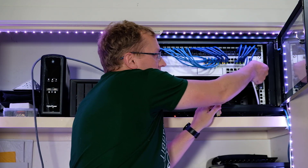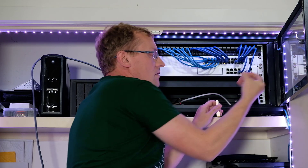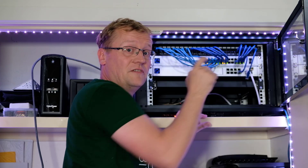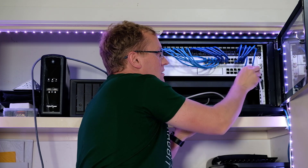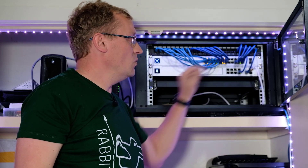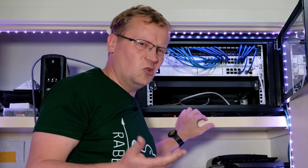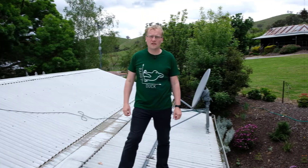Let me just plug that in. I'll take out that little plastic piece here, insert the transceiver into one end - it goes a little click. Then I'm going to unplug this and plug the Starlink in. I'm going to plug the old network connection into WAN 1, so the WAN 2 or SFP Plus port is Starlink, and the RJ45 is my old satellite connection.